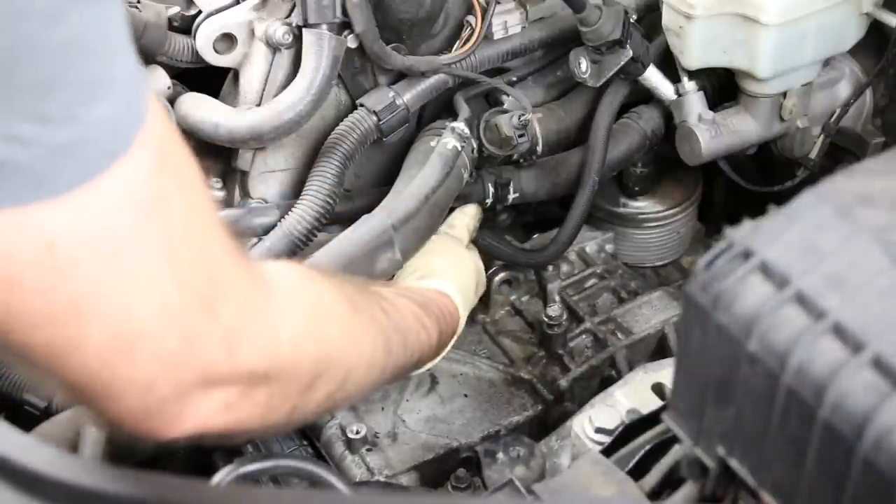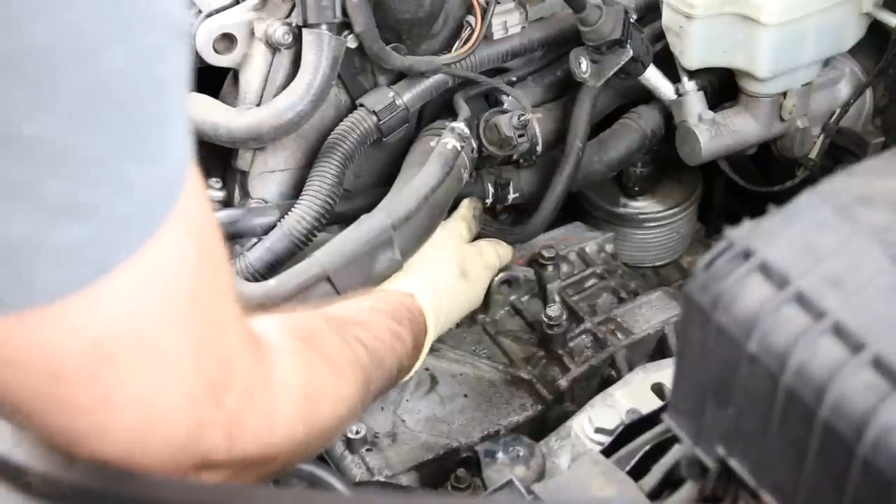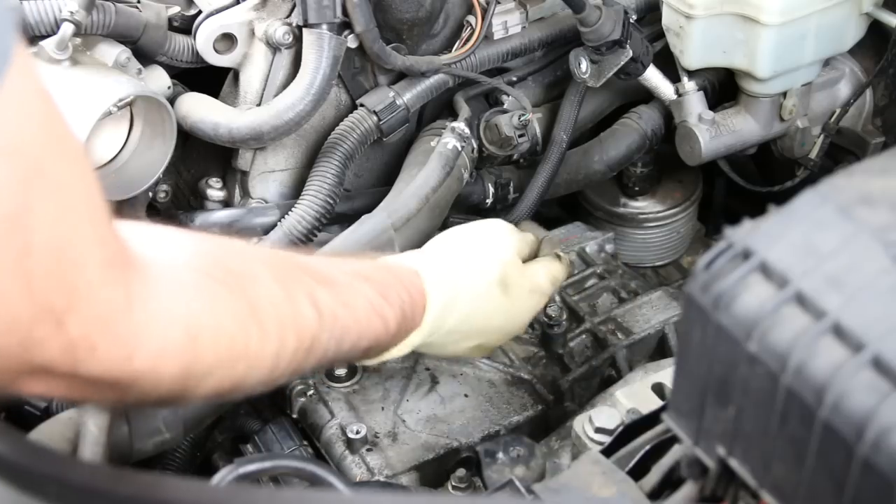Once you've gotten to this point, you're going to want to clean off your engine very, very well. You have the battery tray out and everything's ready to go. Get some brake clean and clean the entire top of the transmission — clean everywhere, the whole area. I would not suggest leaving any oil left there because you will not be able to determine if you still have a leak if you still have oil residue left over. That's the most important part when repairing an oil leak: clean the heck out of the car. Make sure that it's spotless when you're done so that if you have anything else going on after the fact, you can track down where it's coming from specifically. That will prevent you from having to pull your hair out trying to figure out if it's from the repair you just did or somewhere else. Now we are going to pop our vacuum pipe back in place. This goes to the brake booster — this is a big part of the reason why this vacuum pump exists: to make sure you always have power brakes. If you crack this hose along the way, you will want to replace it.